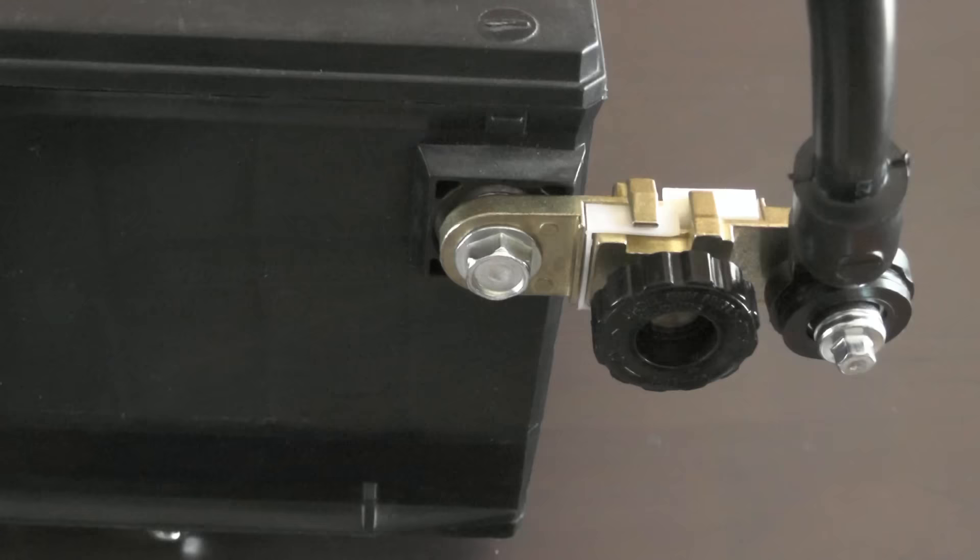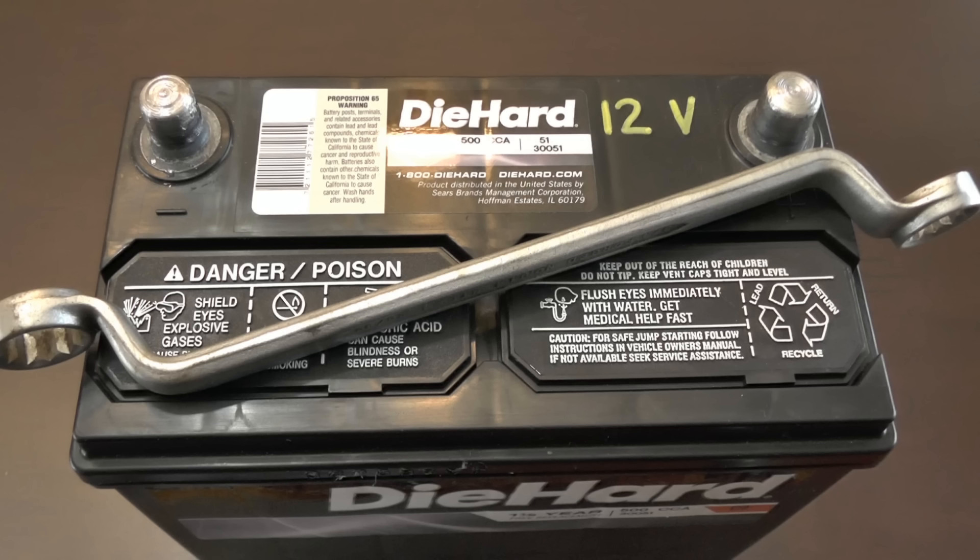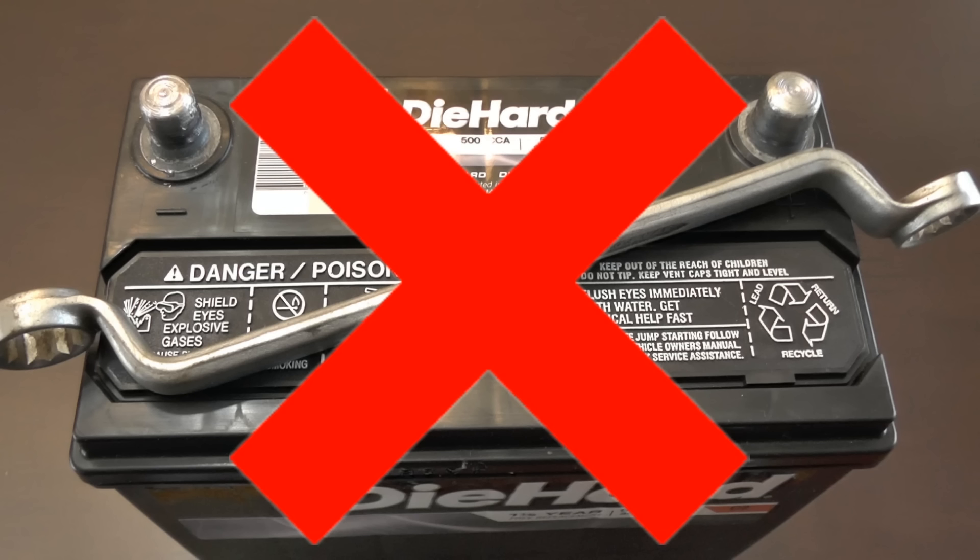I also want to take this opportunity to make a safety announcement. I have seen many YouTube automotive videos in which quote unquote mechanics carelessly lay their metal tools on top of the battery. Never ever do this. If the tool somehow connects the positive and negative battery terminal, or just the positive terminal while touching a grounded part, you will quickly discover that your tool can make pretty sparks. It might even glow red hot. It can even weld itself to the terminals. So don't do it.